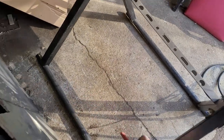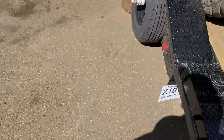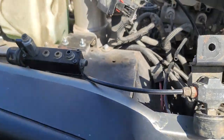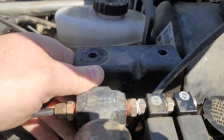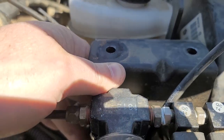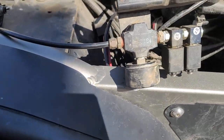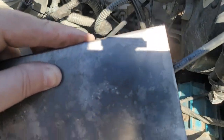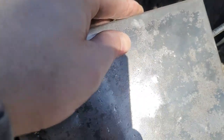Obviously a very cramped shop, so make do. I'm going to take this plate with the marker, come back over to where this was mounted right here. I know this bracket fits — it's actually got a little bit of extra room on it. I can take this plate, line it up along the two edges, and from the back side mark my holes, then center punch and drill.